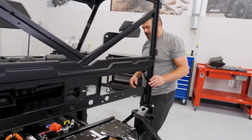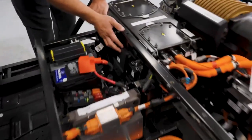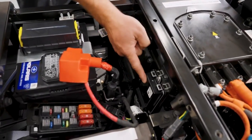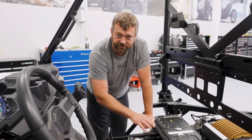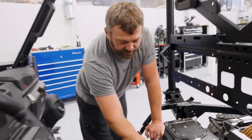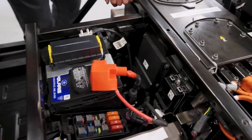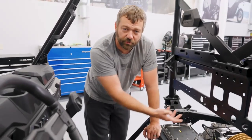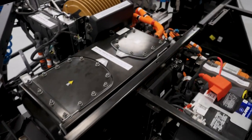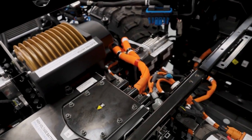When we think about the motor controller controlling direction and speed, where does it get the inputs and signals it needs? Back in the interior we've got two black boxes: one's called the main bike board and one's called the VCM. The main bike board acts as a network translator, talking power steering language along with electric motor controller language so those boxes can communicate. The VCM takes all the user inputs like throttle and brake, controls the motor controller, communicates with the battery management system in the battery pack, and communicates with the charger so all these things can live in unison.